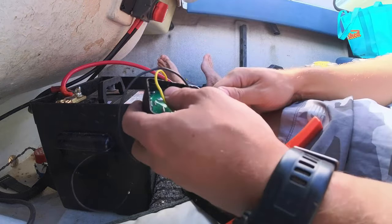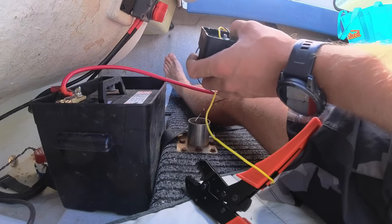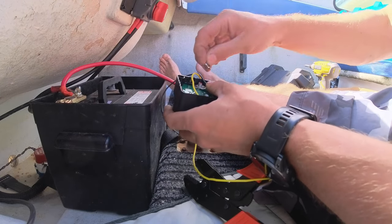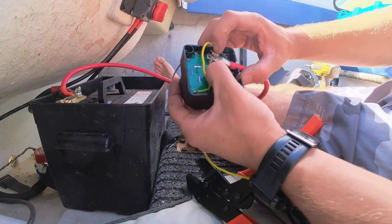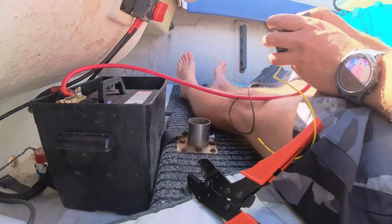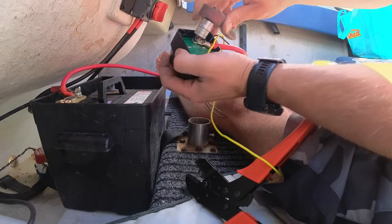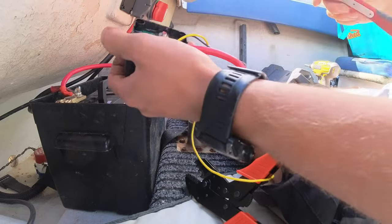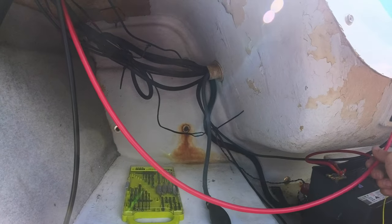You just slap the cable in there — it just squeezes in. It comes with a little locking washer and then a nut, which I'm imagining is 13mm again. If you look there, you can see it says 'positive for the start battery' — obviously that wants to be connected to your starter battery. Tighten that on there. For the other cable you've already seen me run — just crimp the other end and it goes on the other side.